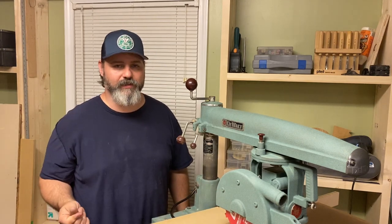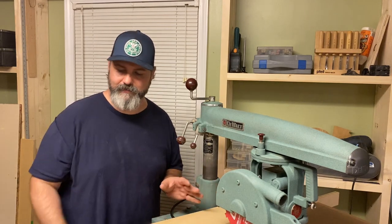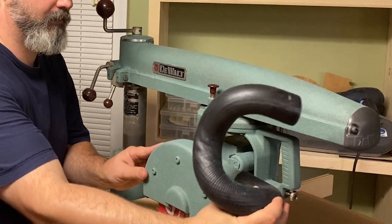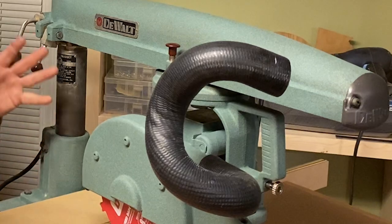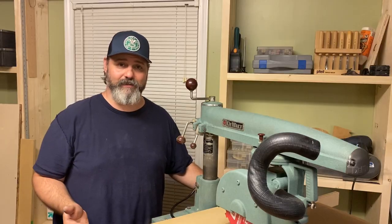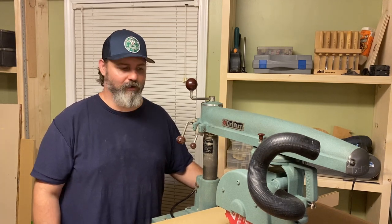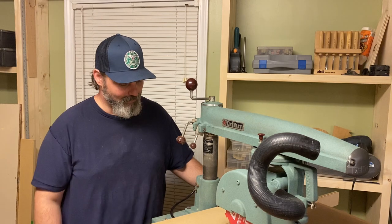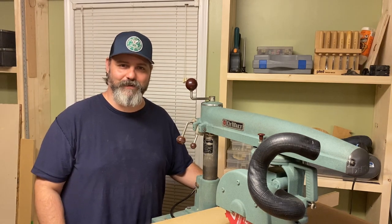In terms of dust collection, I plan on building a box behind the saw to capture dust, as well as adding an automotive hose into the blade guard and cutting it so I can hook up a dust collection hose — pulling dust from both the blade guard and from behind the saw. Once that's done, I think this will be a wonderful tool to have and use. It's already been fun to relearn how to use the radial arm saw — I haven't used one since high school. I think it'll be a great addition to the shop. Thank you for watching the video.